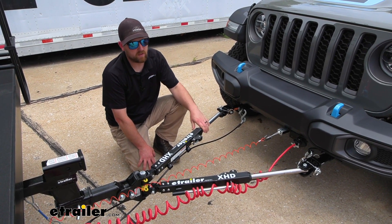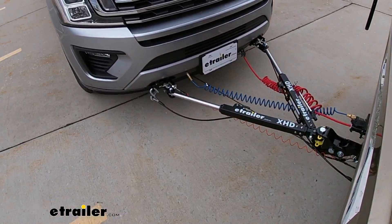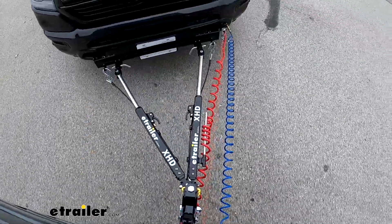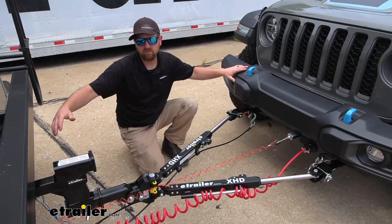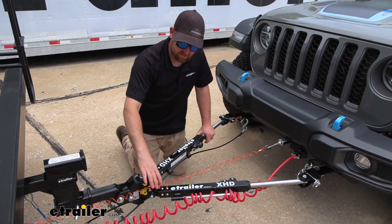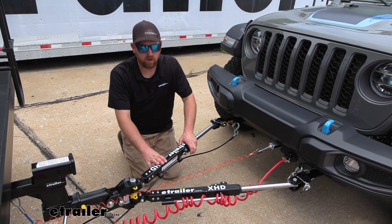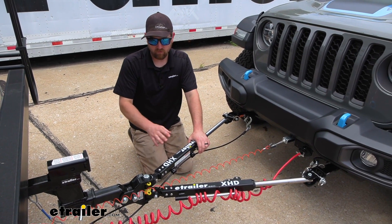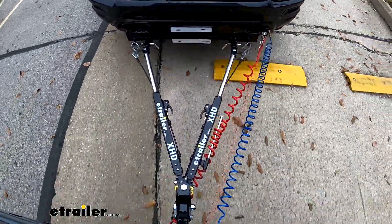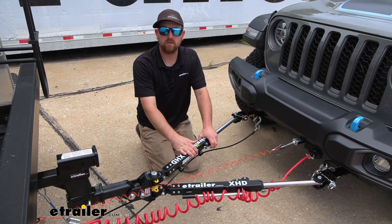One of the things that is really important to a lot of people is how well your vehicle is going to track behind the motorhome — is it going to be responsive, is it going to hold true when driving straight? With this one we should have pretty good luck because it's a relatively long tow bar. Generally speaking, a little more distance between your towed vehicle and the motorhome, the better. This also has two separate arms that can pivot and swing individually, so it's a little more forgiving. This is a heavy duty one, rated for 10,500 pounds — overbuilt for a lot of applications, but it handles potholes and bumps better and absorbs more shock for a better ride when towing behind your motorhome.